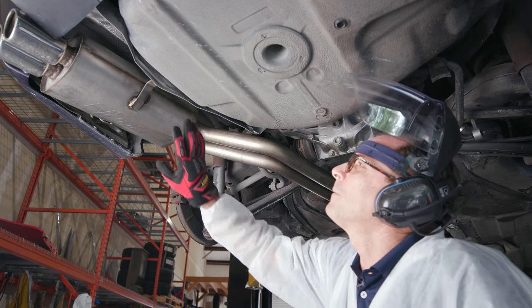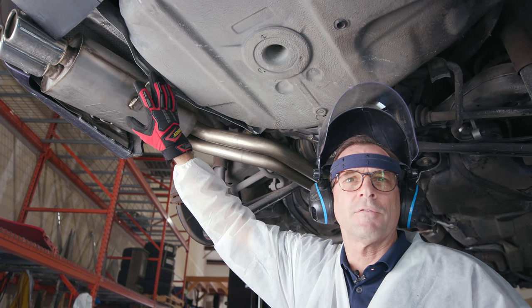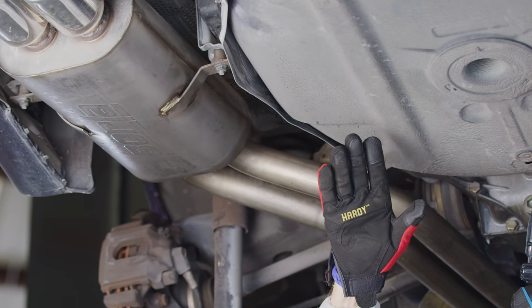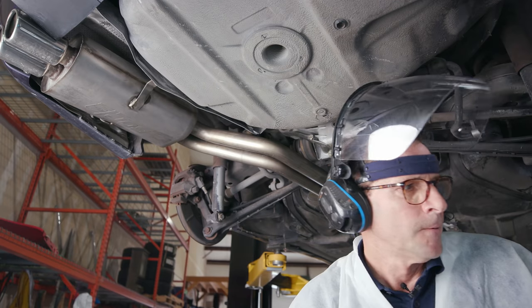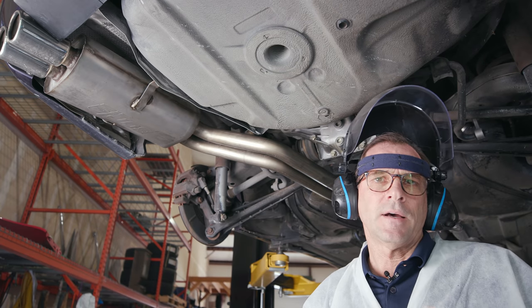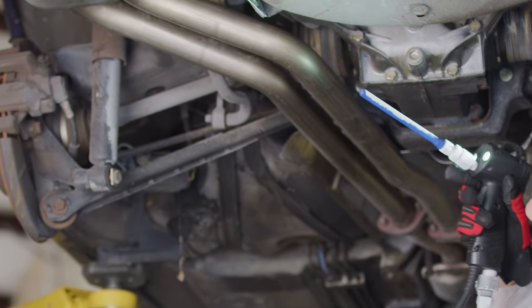Whenever I'm near lightweight aluminum or exhaust shields, I'm always really careful about pressure and size because I don't want to dent it or make it look not stock. So I'm going to tone things down a little bit while we do that shield. What does that mean, tone it down? Pressure. I already had my size at 0.3. I'm going to turn my pressure down to 24 PSI. Just a real light pressure.